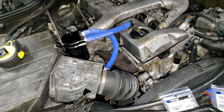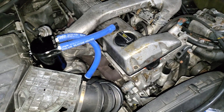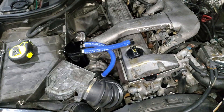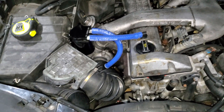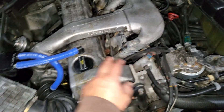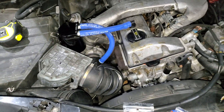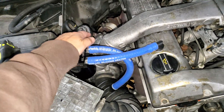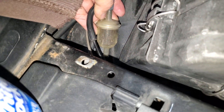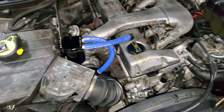There was no major modification — I just had to remove the tube and put this on. If you have a W140 with the turbo diesel, or really any diesel or gas engine, you should have one of these — it helps a lot. It also helps prevent clogging your intake. My EGR was completely clogged right in here, which was one of the main reasons I installed this — to prevent the EGR from getting clogged and to keep oil out of my vacuum lines. You can see oil in there, which is not supposed to be there; it was being pushed through the boost side through all the vacuum lines.